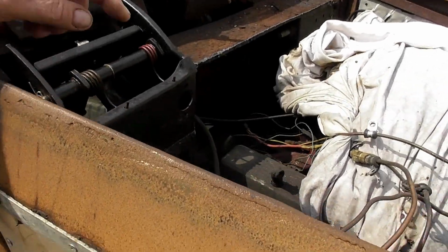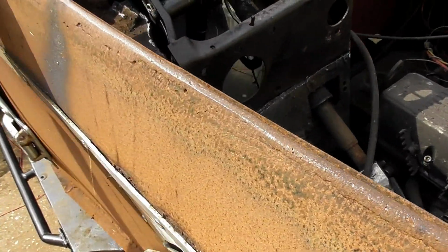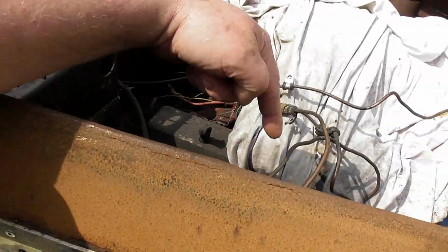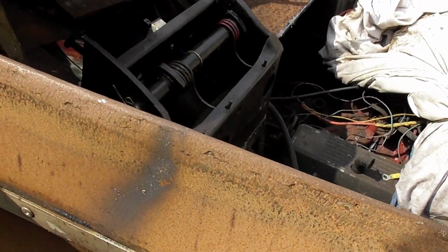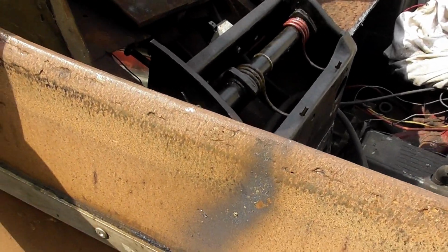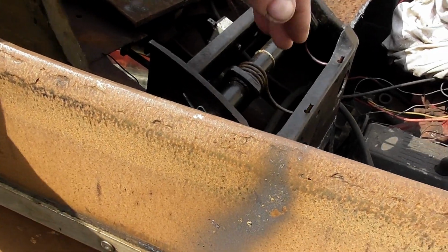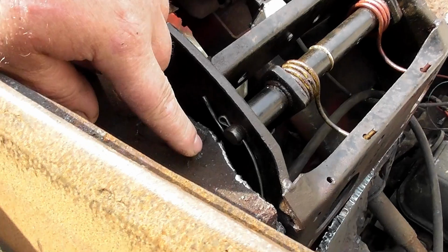I want to cut this down here, right down to that area there, and get that extra inch. Now, I've got to keep this dead square, because when that gets bolted on, that fluid bottle has got to sit dead square, whereas in the previous one it wasn't. Actually tilted up a little bit, and that was concerning for me. So if I drop it down another inch, I've got this point here I can weld to then, and then I can plate this all off.